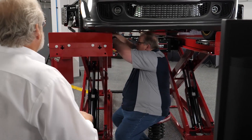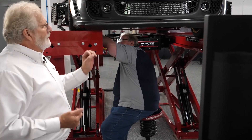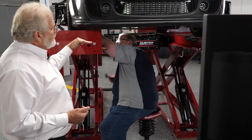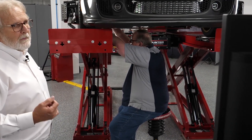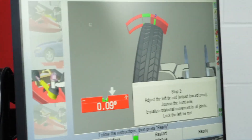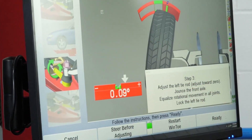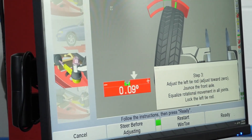Okay, fantastic. At this particular time we're going to tighten the jam nut itself. After the jam nut is tight, we're going to flatten the tie rod back out where it originally was — the center of its travel — and then we'll press the ready key. So now we're on to the left-hand side. This particular wheel is toed in past specification; we're on the positive side, so we're going to toe this wheel out.